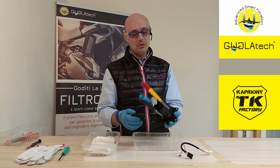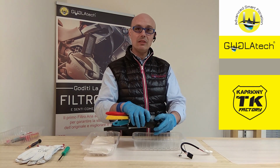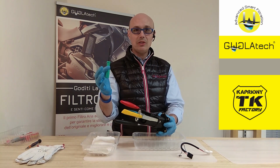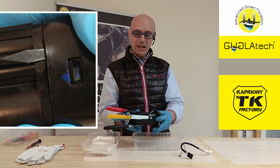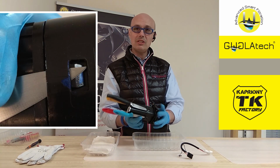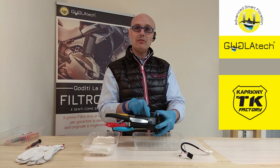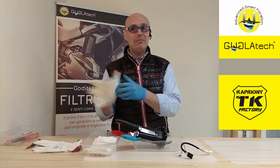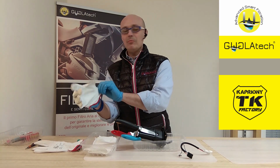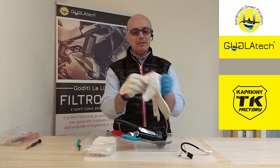To push down all the teeth that are holding the pump together, I wedge a screwdriver inside, make space, and put in the point of a flat knife. I did it on all four sides. All four sides of the pump now have the teeth pushed down by the point of the blade. Now it's going to get bloody. Protective gloves, leather or heavy rubber, are recommended.